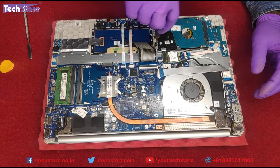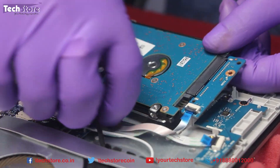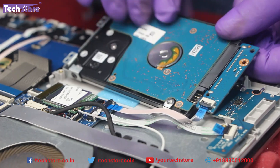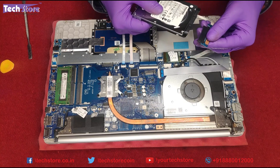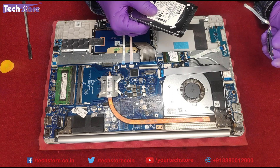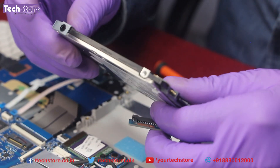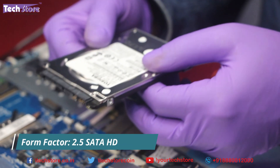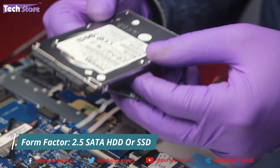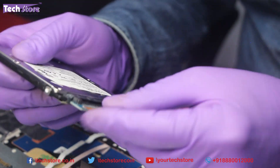For the hard drive, you need to remove one screw, remove the notch, and disconnect this connector. There are absolutely no metal frames — only one screw to remove and the frame comes off. Take a similar 2.5-inch SATA hard drive or SSD and you can install or upgrade the hard drive.